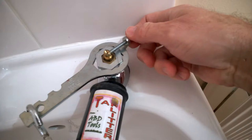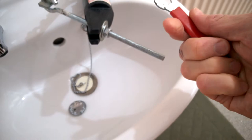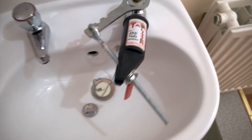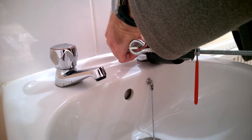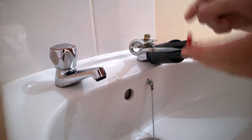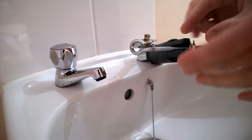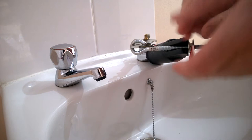You've also got this little ratchety piece here so you can use that over the bolt to give you some extra purchase. That's basically how it is - ready to go. Make sure everything's nice in line, just make sure it's all straight, and then start winding. It's really low gears so it doesn't happen very quickly, but you'll be able to see this coming towards the sleeve tool, and you may get a click as it undoes.